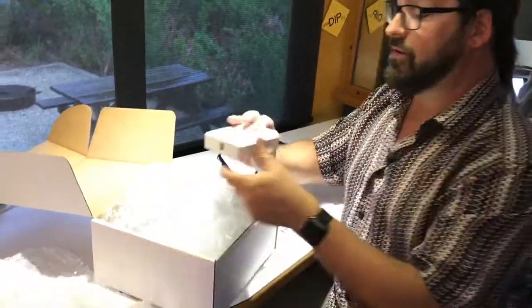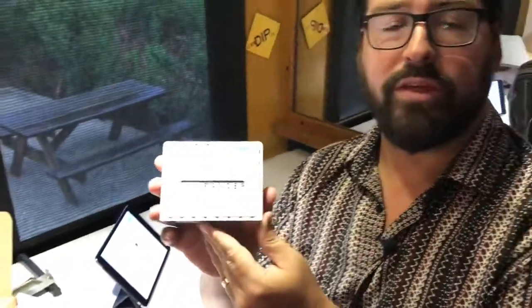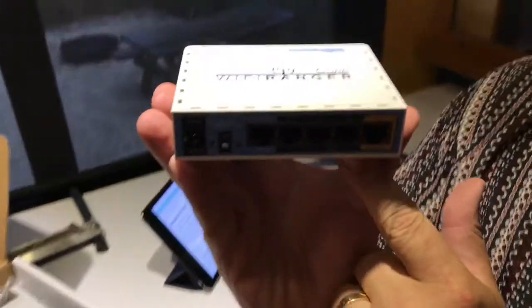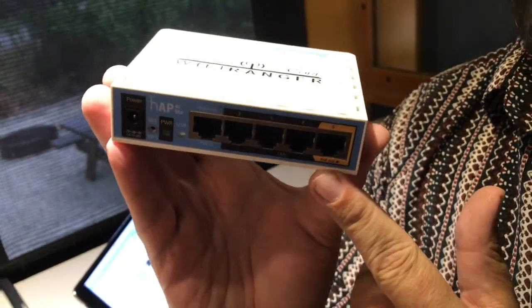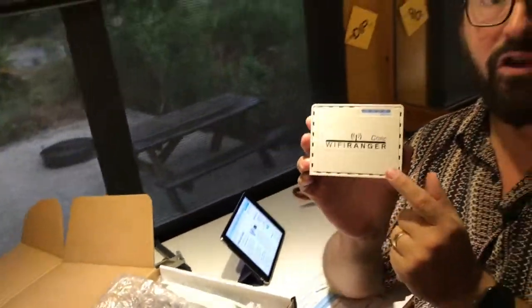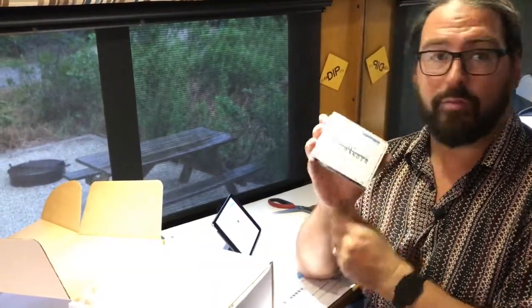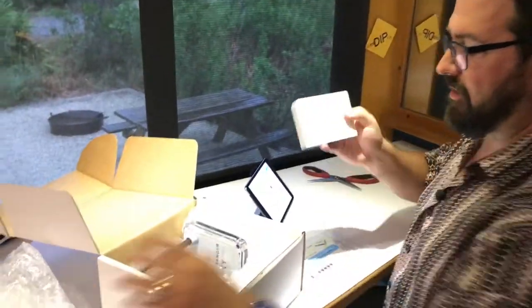Here is the Wi-Fi Ranger core router, which we have reviewed separately. It's normally $159 by itself. It's a nice 802.11ac indoor router. It is lacking in gigabit ethernet ports — these are just fast ethernet ports. So for people who have more demanding indoor networking needs, we recommend upgrading to the GoAC indoors. Wi-Fi Ranger doesn't sell that as a kit pre-packaged, but you can buy the components separately, and it prices out with no special discount for getting the kit.